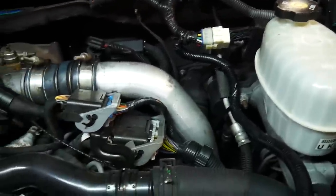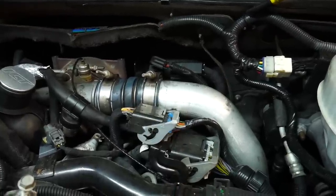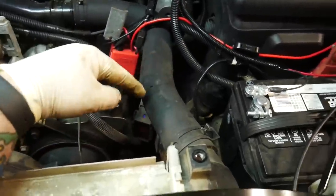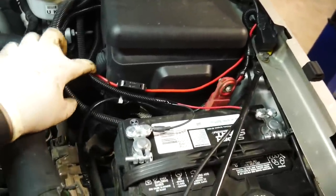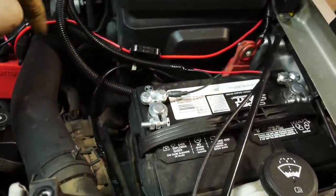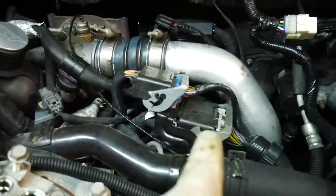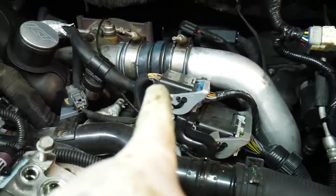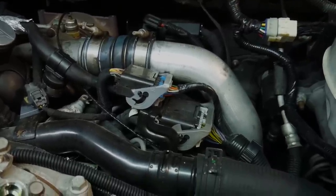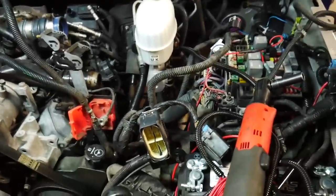Up here up top, we're also going to be needing to unhook our hot side pipe. That one will come out there and we'll unhook it down underneath as well. We're going to take off our upper radiator hose to go over to that part. And then we're going to need to finagle out a lot of our battery and accessories that's hooked up around here and to the PDC as well. We're going to need to unhook our main engine harnesses, one and two right there. I know it looks like a mess, but we are making progress here guys, promise.